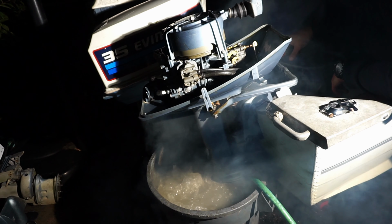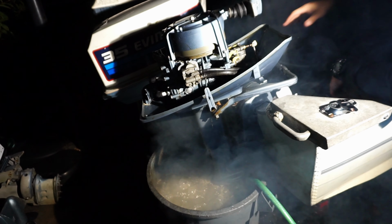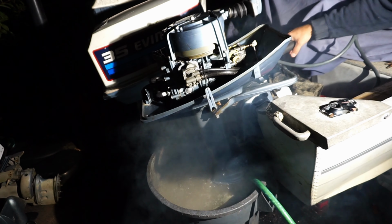That's a wrap, boys and girls. That's it. This one was easy, guys. It's the same thing every motor, pretty much. Especially when it comes to the little 5.5s, the 60s, 50s. Very, very similar. Especially this little vintage, very much the same power heads, the pump, the way they shift and stuff. So that'll wrap up this cute little 63 with the cooler style hood, but it's the same block and everything. Pumping water nice, runs. He'll have to adjust the high speed on the water, but sounds good to me.